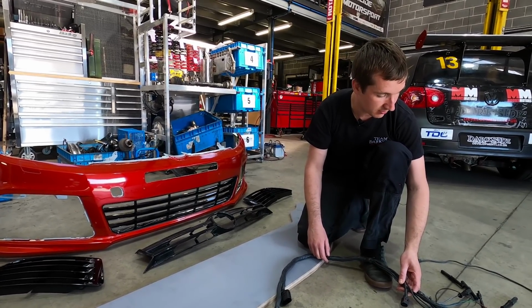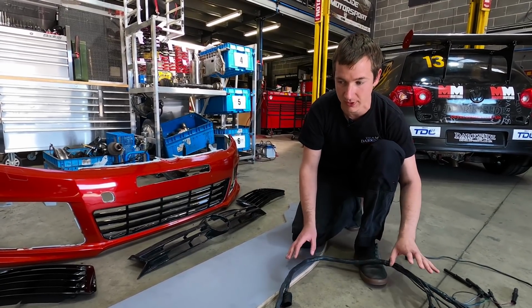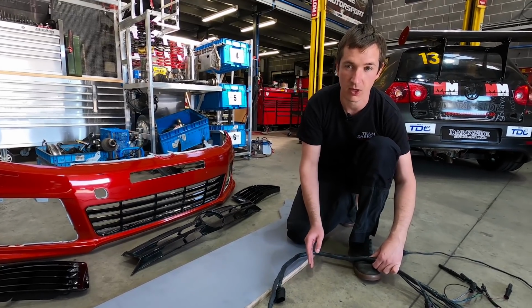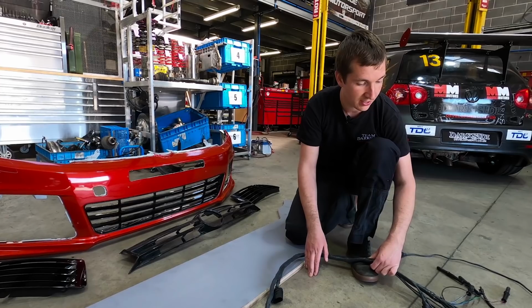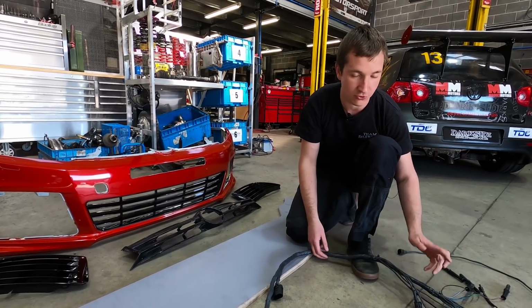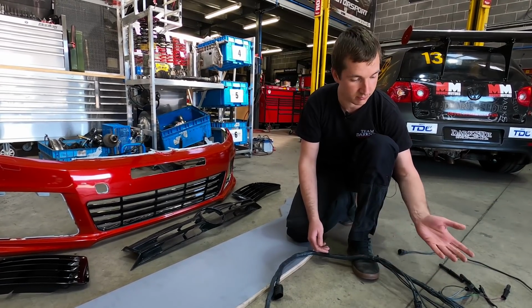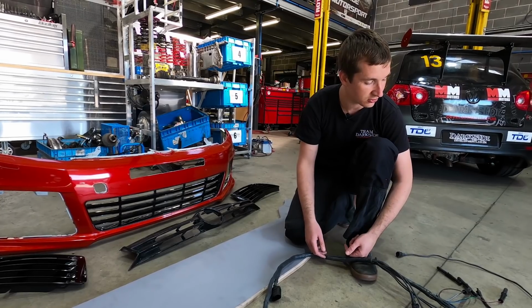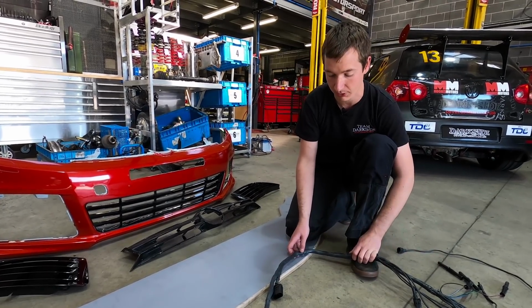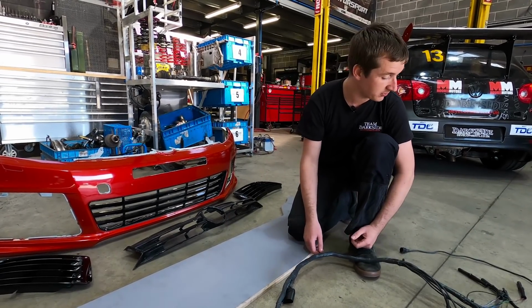And it basically made Paul strip out every little bit of stuff that we didn't need to use, because he was very worried that if we ended up with a wire rubbing or chafing somewhere that we weren't even using, like one of the redundant wires that's on the loom at the minute, it could drag all the reference voltages down, or put a positive to the earth, a short to negative. So they were a bit worried about that anyway. I'm not the wiring guy, Paul is, and he said this is what he'd done before we raced it, and we're going to have time to do it.